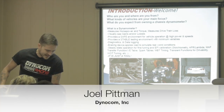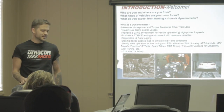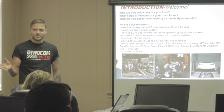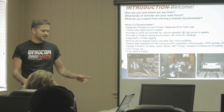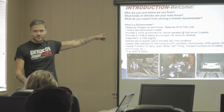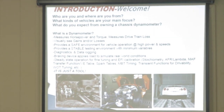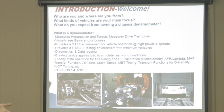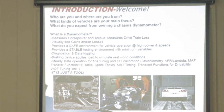I'm Joel, and I'm going to be teaching you guys the chassis dynamometer operation training for DynoCom. What is a dyno? Everybody knows what a dyno measures — horsepower and torque. But it also measures acceleration, speed, and drivetrain loss. On a chassis dynamometer you measure power at the wheels. You can visually see gains and losses — that's part of the tuning process when you're adjusting timing, adjusting AFRs, and raising boost levels.